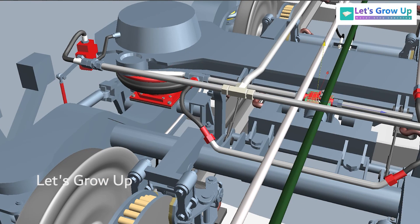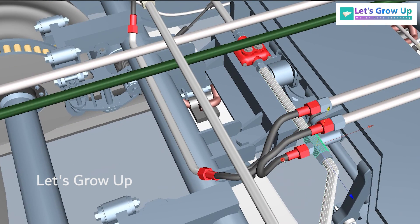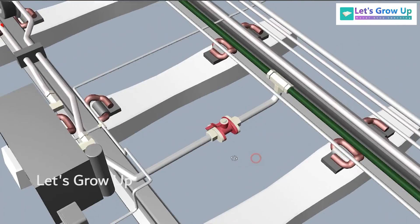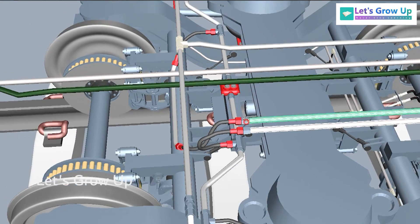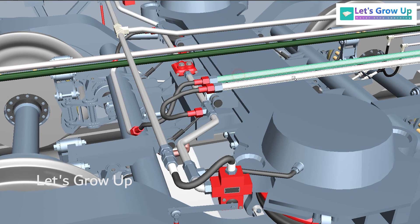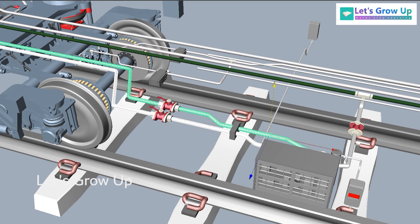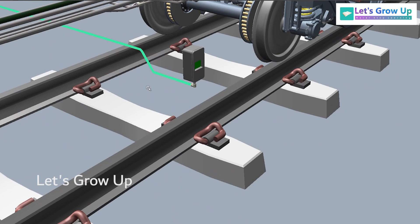On the other side again: T-joint, flexible pipe, T-joint, flexible pipe — and this pipe is going to FIBA, and this pipe is going to FIBA, with an isolating cock. These two pipes sense both side air springs. If there is any leakage or damage in the air bellow, these two pipes sense the air for the two air bellows. These two pipes are the FIBA connection.